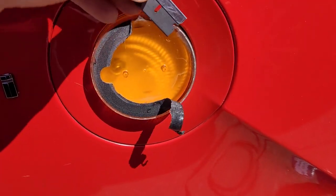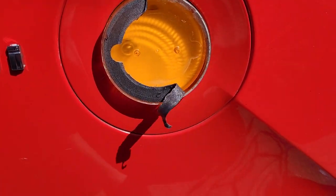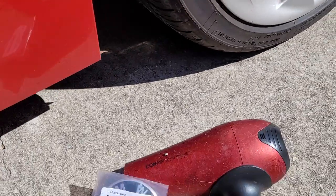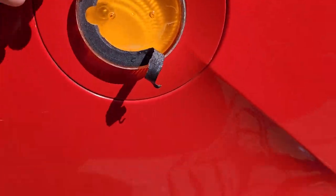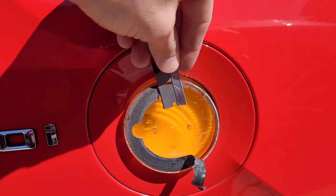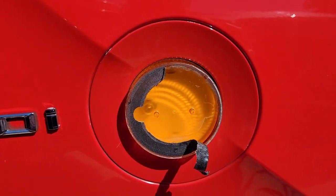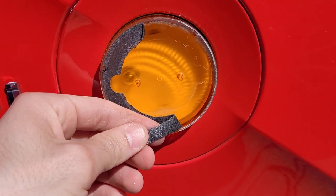...just went to depth of the blade around circumferentially, and then came in with a hairdryer just to heat the badge up, and then came in with the blade again, standing it more vertically to get through the entire 3M sticker, or the adhesive pad here.